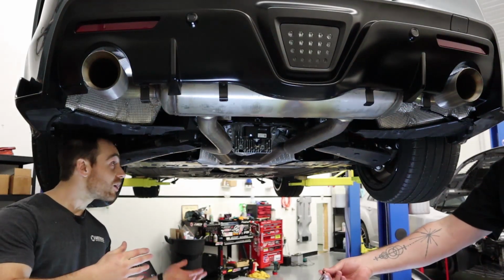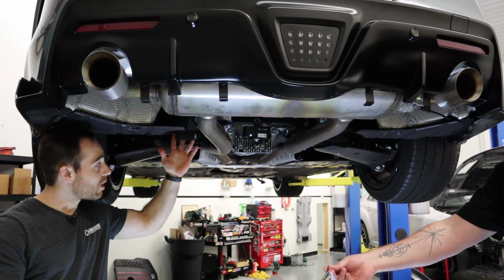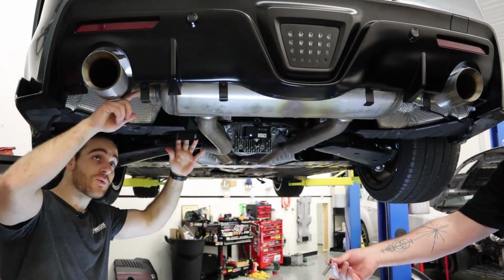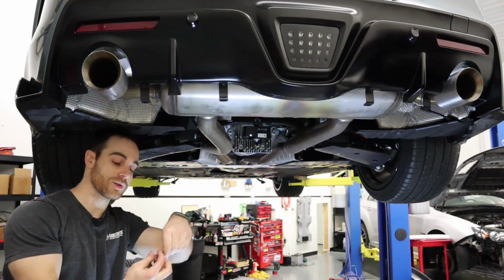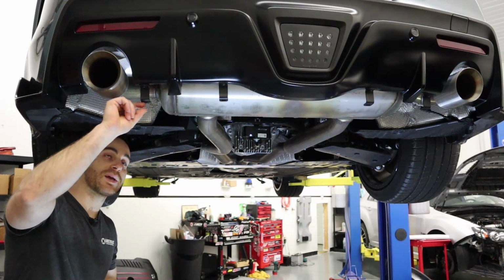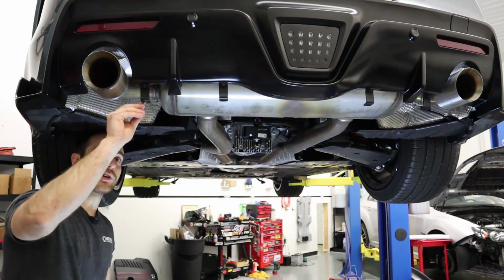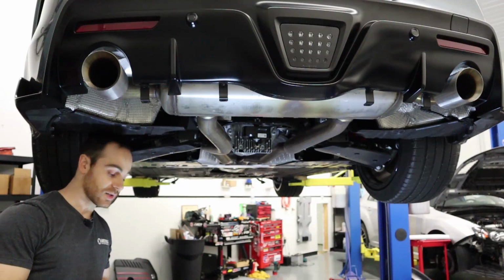Basically, you're gonna flip it over, and obviously the two bolts go in the front. We normally recommend bolt, washer, and then the nut will go on the diffuser side. Same thing with the rear. However, you're probably gonna want to use the longer bolts on the rear because there is a potential that you'll have some spacers to either fit your exhaust tips or the exhaust, so you can then install the rear diffuser at different heights based on the nylon spacers. Let's get to it.